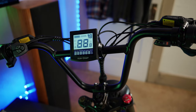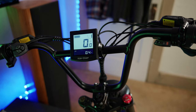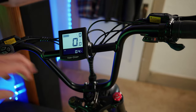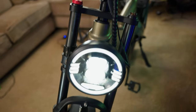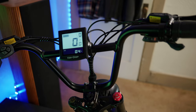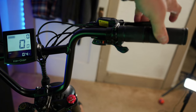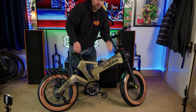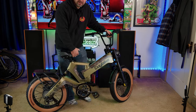Over at the cockpit, you hold down the power button and the display pops on — the front running lights come on immediately. The display shows pretty basic info: power meter and pedal assist level toggled via up and down buttons. You can turn the headlight on and off with the headlight button. Pressing the info button cycles through trip odometer, odometer, time, and max speed. It has a half-twist throttle, Logan hydraulic disc brake handles that feel nice, and the Shimano eight-speed trigger shifter.